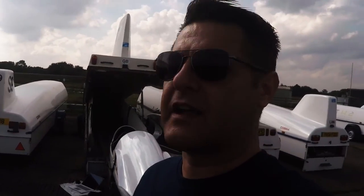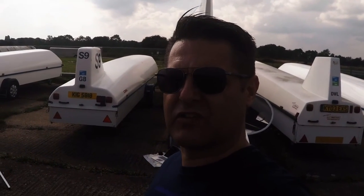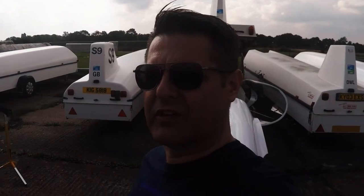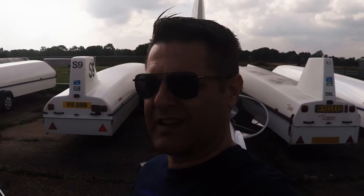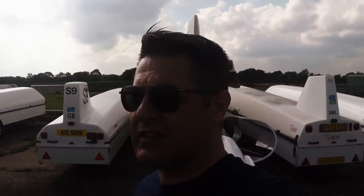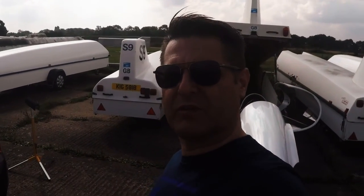So that's it. A couple of people asked how I've overcome this, and it was a concern when buying this type of glider. It's not a problem at all as long as you know what you're doing — it's just about making sure it's absolutely safe. The other thing I do is a positive check: I'll ask somebody to hold tightly onto the tailplane while I do the up and down movement to create resistance against it. If it's creating enough resistance, we know it's on properly — which you do anyway after rigging a glider, because you check the airbrakes, ailerons, and rudder as well.